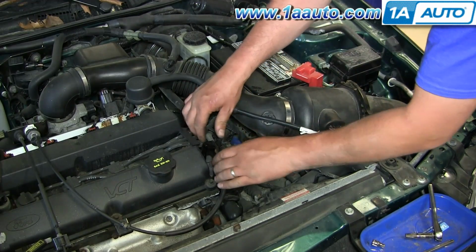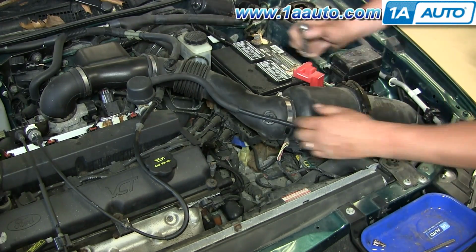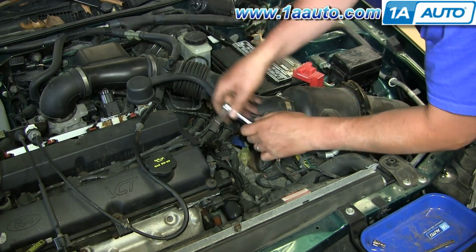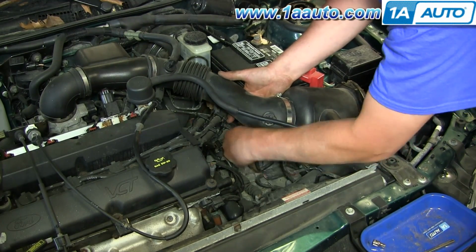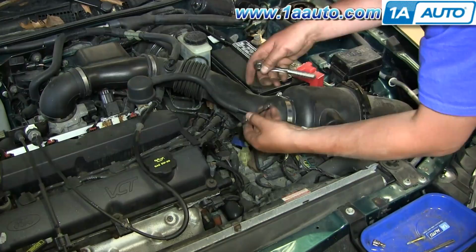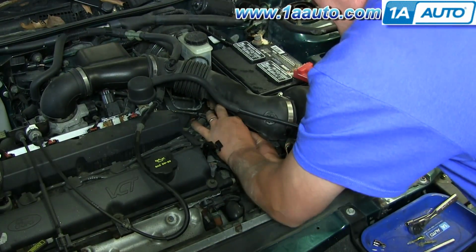To get to the ignition coil, I'm going to pull the accelerator cable out of the way without bending it. And then I'm going to remove 4 7mm screws that are on either side of the coil. Okay, we're just using a 7mm socket with a ratchet, and we'll speed up here as we just take those screws off. And you can see every once in a while we do switch to an extension on the bolts that you can use an extension. It just makes it a little bit easier.